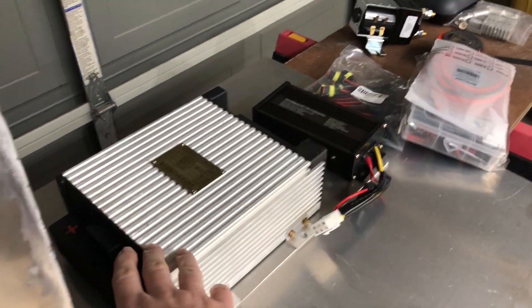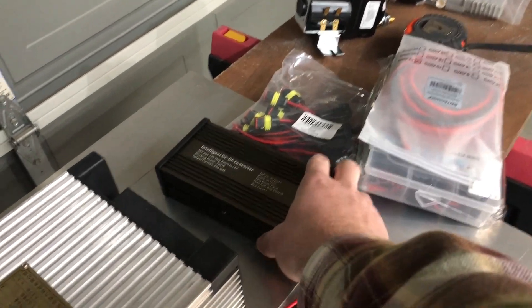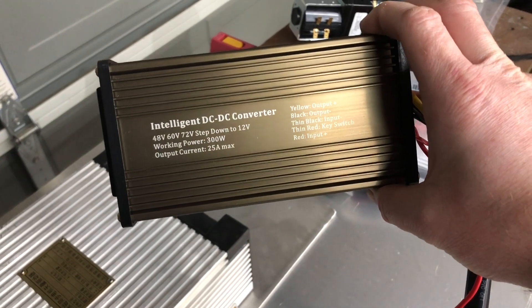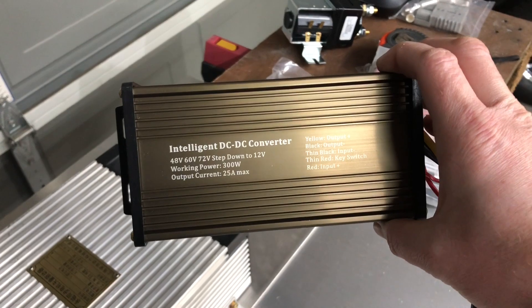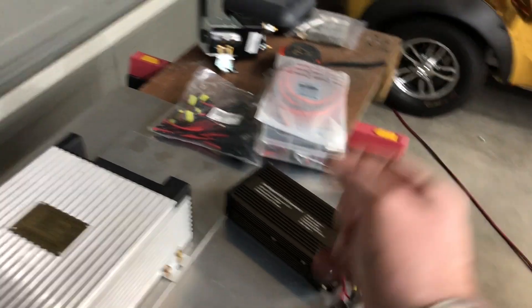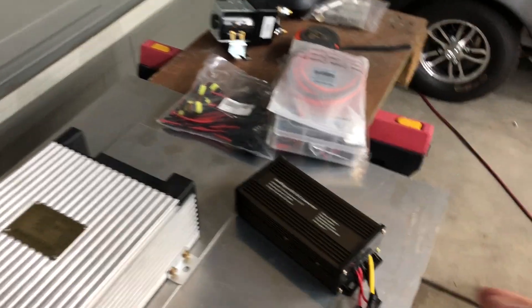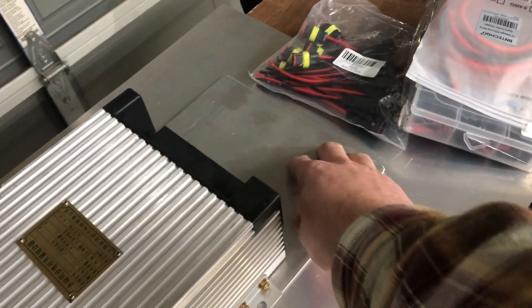On top of it we're going to have all the electronic hardware — the controller and DC-DC converter. The one I ordered, I didn't realize, when I switched over to higher current the voltage capability of the input dropped down to 72 volts or less. So I've got two coming in at 180 watts each — I'll have one on the headlights and one on everything else. I'm also going to have the contactor and the shunt up in the front, since the shunt goes on the negative battery terminal and the contactor goes on the positive.